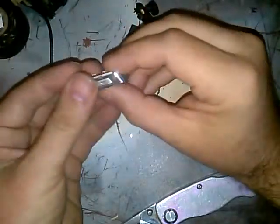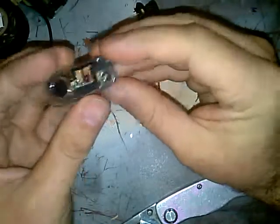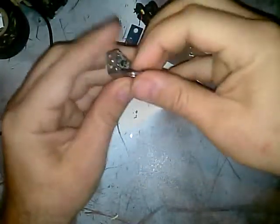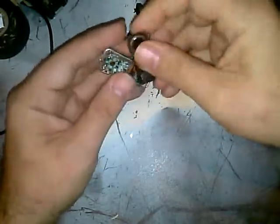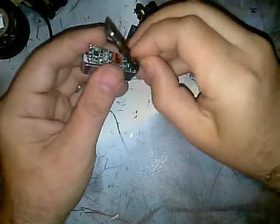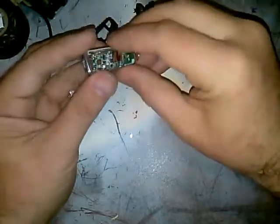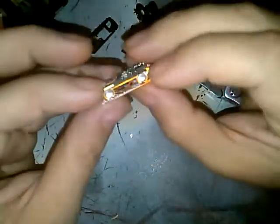I'm going to assume this part has to pop out, probably towards the front. Motorola isn't always doing industry standard things, unlike their phones. It's got a plastic collar around it — this was really big in the Nokia 5000 series phones. Pulling it all out, working around the antenna. There are the circuits and power switch, volume push buttons, and this is an RF shield for the Bluetooth chip.